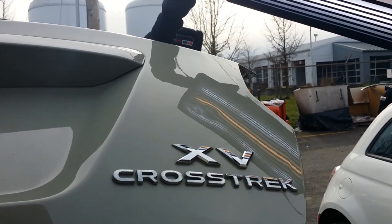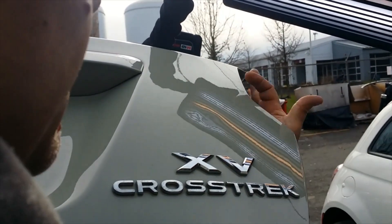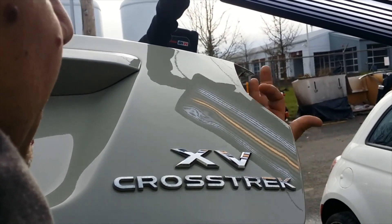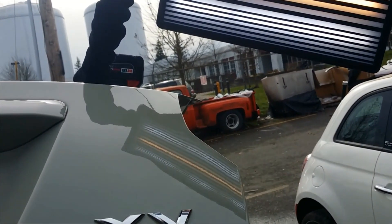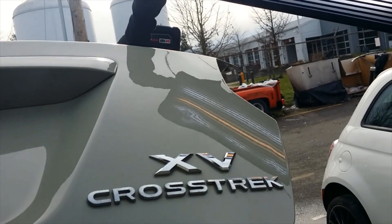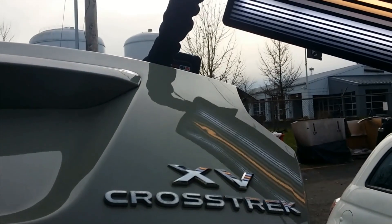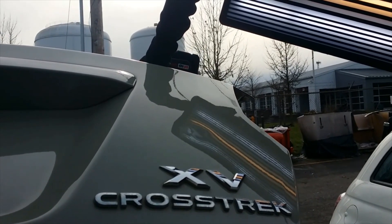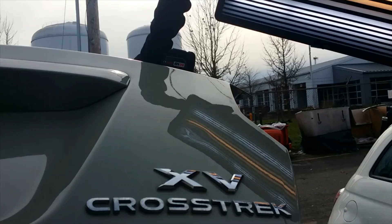Tapping down a high spot that maybe got stuck. This dent is going to come out real nice right here. I don't know if you can see this edge, but if you go up a little bit higher you'll see that the edge has a little tug right where the metal was folded over against that edge. There is literally not much we can do with that — I can tap it down a tiny bit.